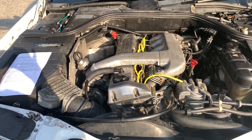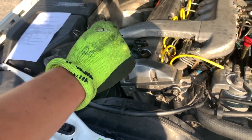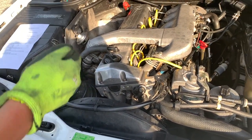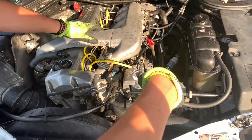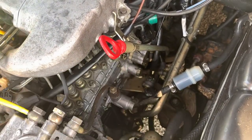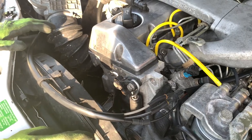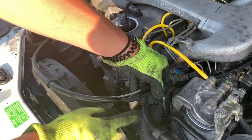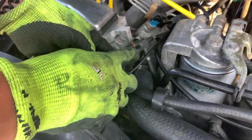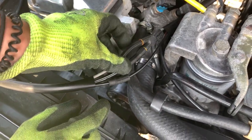One more important thing is the vacuum lines. On these model engines up until 1995, they use the vacuum lines to turn off the ignition when you turn the key. If your vacuum lines aren't set up properly, your engine won't turn off when you turn the key, and you're going to have to run up and open the hood and press the emergency stop, which everyone should know about if you own a diesel. The vacuum lines on the W140s are pretty standard. You have a three-way junction going into one line that comes from the vacuum pump. The yellow one runs to your climate control unit to open and close the valves inside, and the orange one has something to do with the door locks.